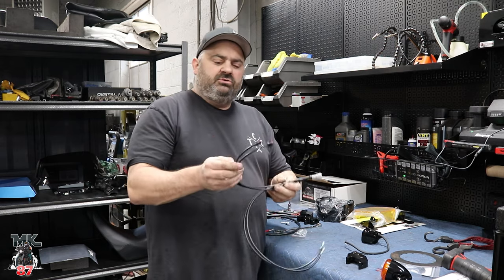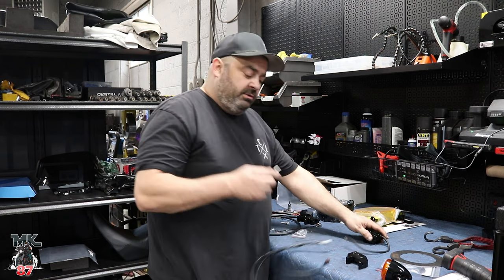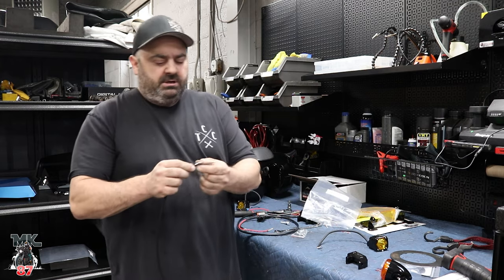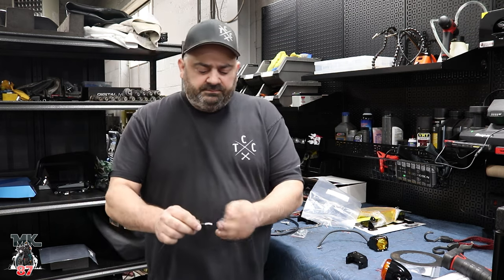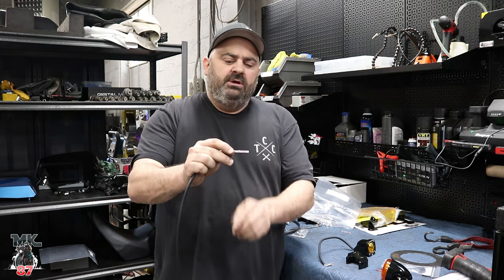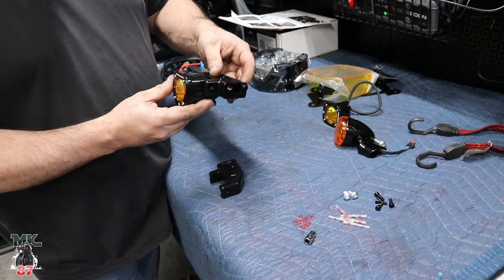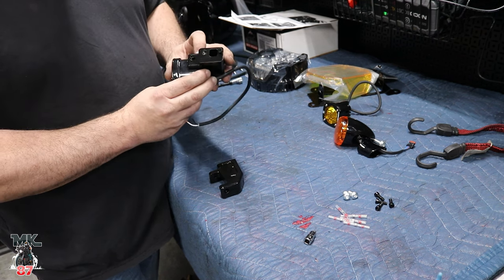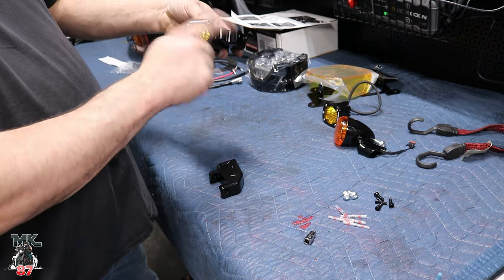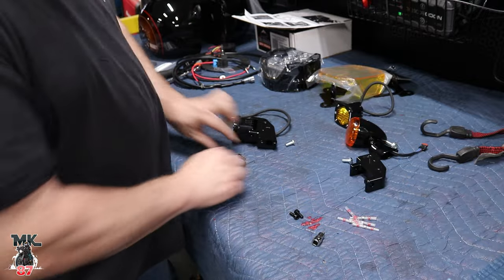So it looks like the harness that they gave us — these two plugs are going to plug into your factory harness for both blinkers. The other side though, they just gave you bare wires for each side. What they've included in the kit with those bare wires is these butt connectors with the solder in the middle. Essentially what you do is strip off both ends, twist them together, get them inside the butt connector, heat it up and the solder melts into the wire. We're going to mount the light into the mount off the bike because it might be a little tight accessing the inside screw. We also have to flip the screen on the front because your Baja is upside down. They provide mounting screws for the mount to the bike and then mounting screws for the light to the mount.